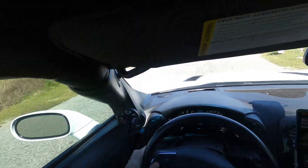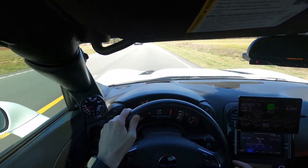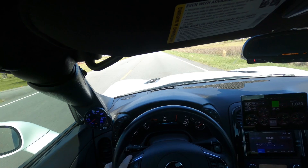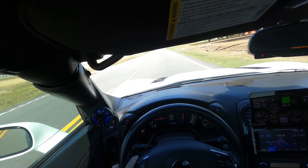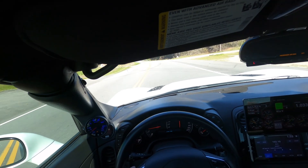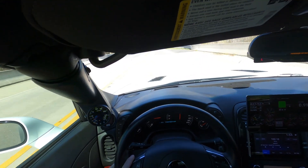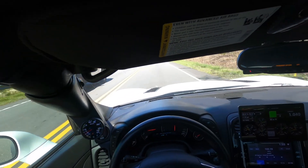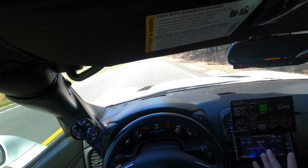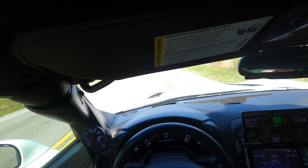That's pretty much an overview of how this works. One more pull to show you the complete lack of lag with rear-mount turbos. These aren't particularly big turbos, but they're rated at 750 horsepower each — my goal is to make 1000 horsepower on tire reliably with a built motor, so I purposely sized the turbos optimized for that power level while maximizing spool. Let me know what you think, if there's anything else you want to see, or if you have any questions on Max ECU. Both Max ECU and rear-mount turbos are a great fit for the C6 platform — out of the 30-something cars I've had I keep coming back to C6s. Thanks for watching.